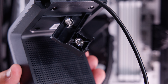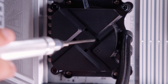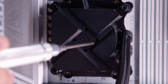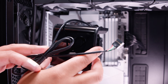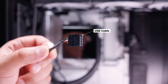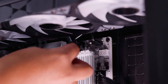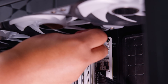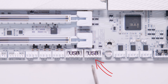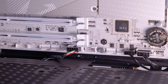On the OLED screen, you will see four pegs that help with aligning the screen onto the pump top. On the pump top there are four holes which give you an idea of which way to orient the screen — it can go in almost any orientation you like. Line it up with those holes, make sure the pegs go into those holes, and the magnet should hold the screen in place. Locate the USB cable that comes off the screen, feed it through the backside of your case through the pass-through holes at the top of the motherboard tray, then locate a USB header on your motherboard and plug that cable in. That's it for installation and wiring.